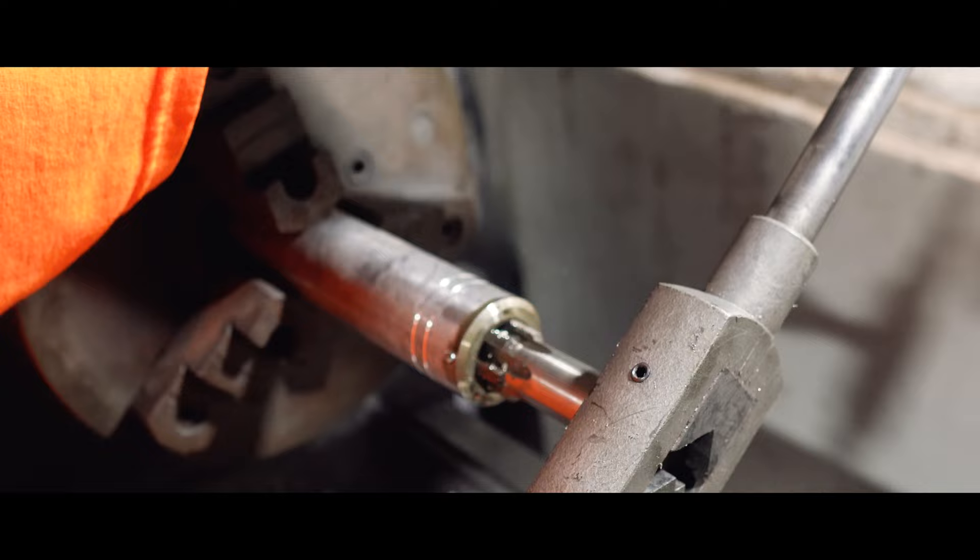Hopefully you saw some of the action shots of my brother Rob doing the control arms. He starts with solid aluminum bar, cuts it down on the bandsaw, bores it out with a drill bit, and taps it — all done by hand. I haven't ever had one of these break or have any threads pull out. If you're considering anything for your next build in terms of control arms or steering, go with 7075 aluminum — they're strong and they look awesome too.